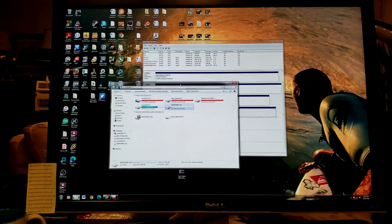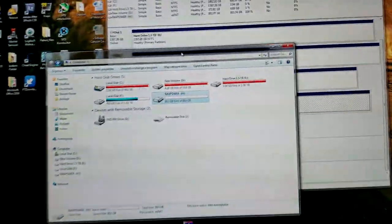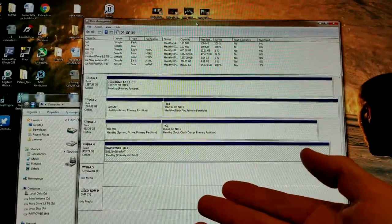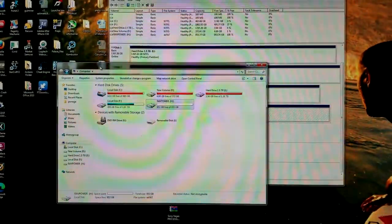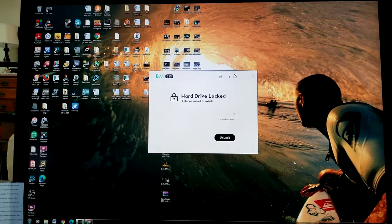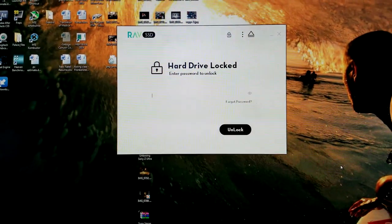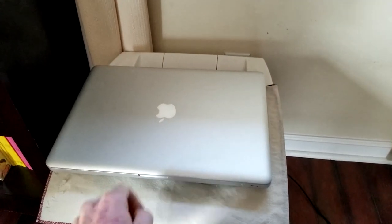Let's go ahead and connect this and see how she fires up. I plugged it directly into my Windows 7 computer. Unfortunately, it did not recognize the RavPower SSD drive, so I actually had to assign a drive letter in disk management, which was really simple to do. I made a separate video about it on my channel. Once I applied the letter H to the RavPower, it showed up. Just a heads up if you're using a Windows computer and it does not show up. The RavPower SSD also has 256-bit security encryption that you can set up. It's working great on my Alienware Windows 7 computer, and of course it can also be used with MacBooks and other Apple devices.